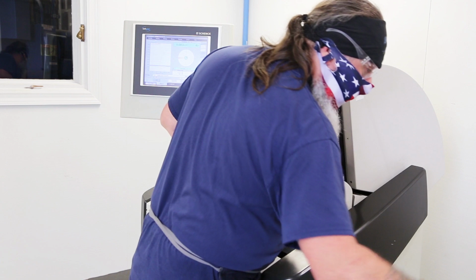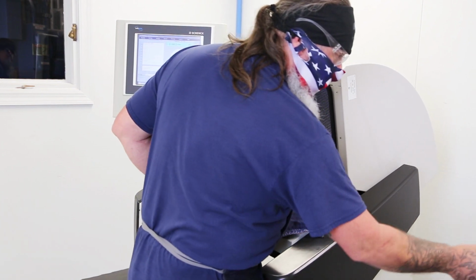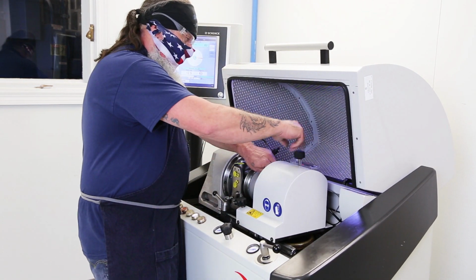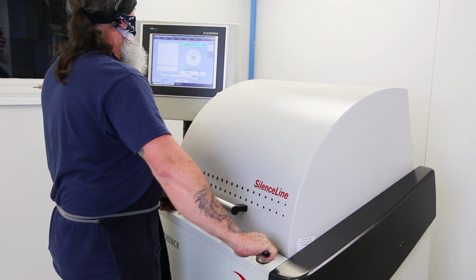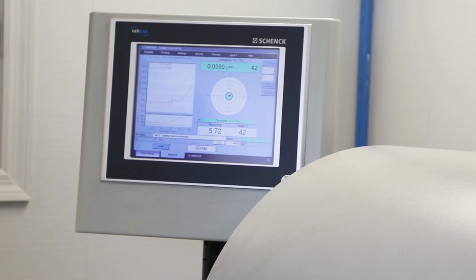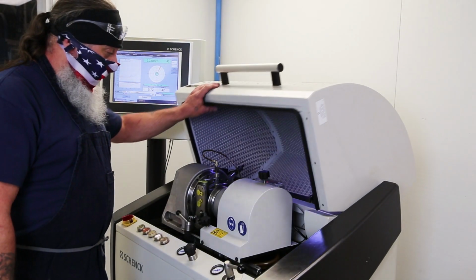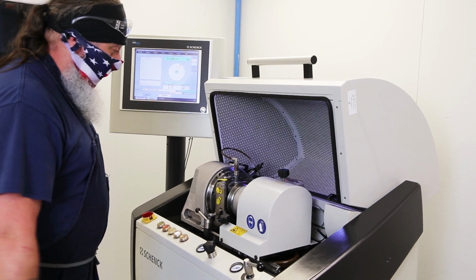As you can see, it does not take much at all. This one here was pretty darn close already. And then we'll do this again. Now we're down to 390,000, and I'm going to call that good, very good actually. We can get them a lot closer, but it takes some time. And like I said, it was already within tolerance, so there's no sense in wasting a whole bunch of time trying to get it any closer. But that's what we do in our balance room.